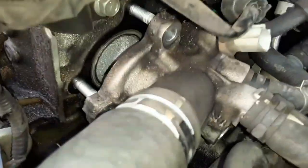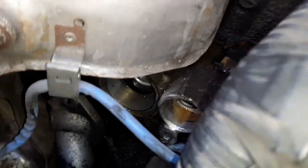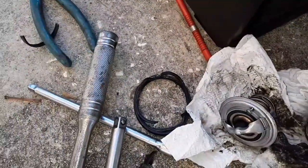I did manage to do it this way, pulling everything off. It was tough getting to that bottom bolt but I finally did — just take your time. I'll have to pull that black gasket off, and I've already pulled out the thermostat. You can see the water pipe down there — that's where the thermostat goes. There are the old ones, and the rubbers came off them.